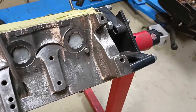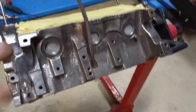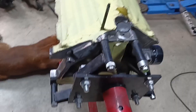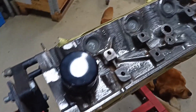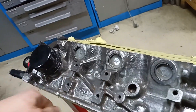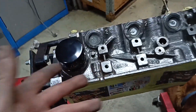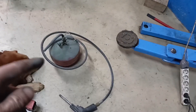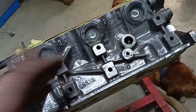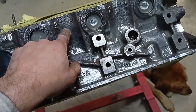Check this out — we've got a really nice shiny engine block right here. It's actually quite tempting to just spray some clear coat over it, but no, we won't be doing that to this engine. I cleaned the whole surface to be painted on both sides, and it turned out pretty good. Some places are really hard to get to, so I did my best with the screwdriver tip and the smallest tools. Now I'm going to use this blowtorch — I'm just gonna go over the whole block, heat it up with the propane torch, and then wipe it off with some paint thinner to do my best to remove all the oil that might be ingrained in those pores of the material.